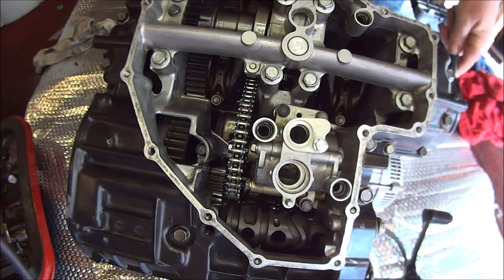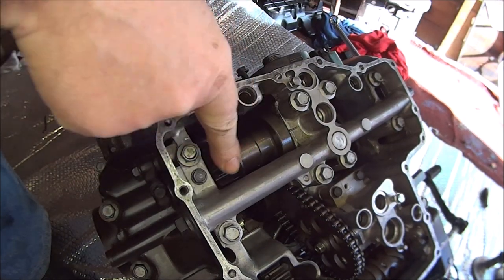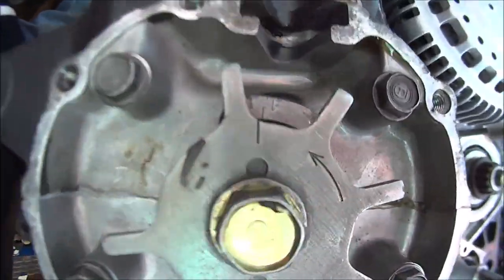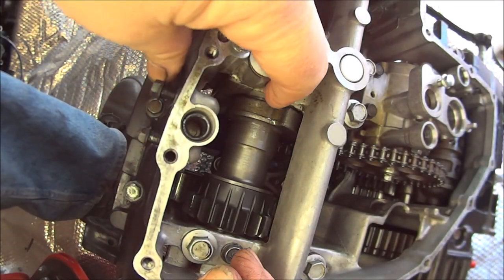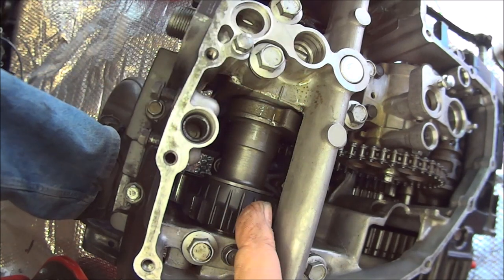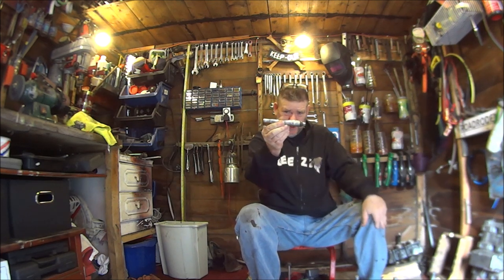Then as always, put your spanner on, make sure everything's turning. Perfect. I've got to set this balancing gear up because I did set it all up when I was putting the crankcases on, but I was concentrating that much on setting everything else up, I forgot about this. Okay, the engine is upside down, but we are set to top dead centre there. You can probably see there is our locating mark, and our alignment mark is down there somewhere, so it is way out. So we've got to bring this in line with the alignment mark. So I'm going to go and read the book, and read it again, and again. And if your shaft was seized up like mine was, it's going to be a bloody nightmare.